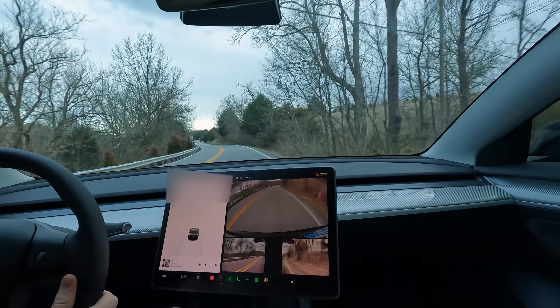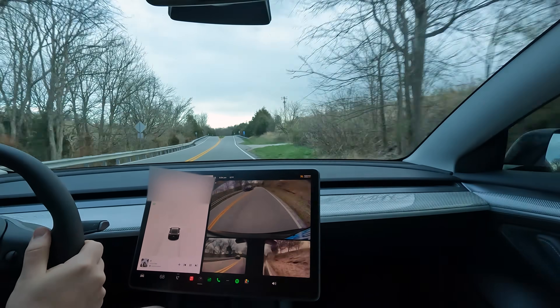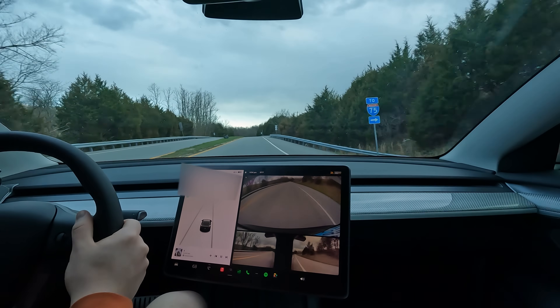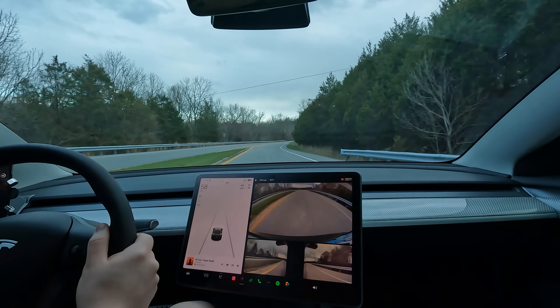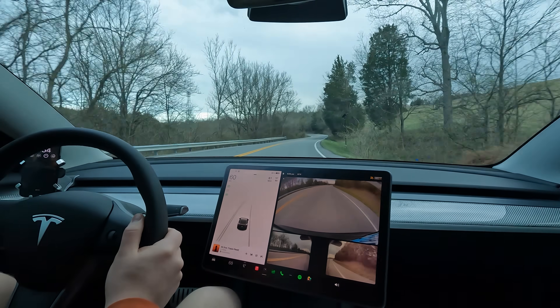Or you could just be like me and a bunch of other Tesla owners — you don't really know how much you drive daily, it varies drastically, and you just throw a 14-50 in there because you still want fast charging so you never have to worry about charging, but you also don't want to spend $1,000 on a wall connector and still not even have anything to put in your car to take around with you in case of emergencies. And like I said, if that is you, consider getting the corded mobile connector instead of just two of the normal ones.